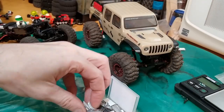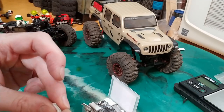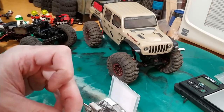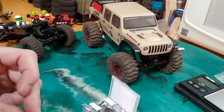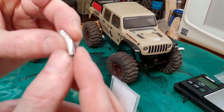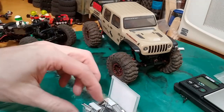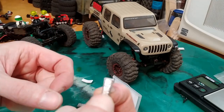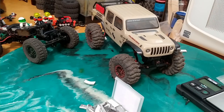So if you're looking how to get these bent like this, I just take a spark plug socket and a pair of channel locks, slap it down against it, and just squish it. You'll notice the channel locks have a little indentation inside of them, for grabbing pipes, round things. Just use that and go around, and you'll slowly get it shaped like this, which is pretty sweet. You get a bunch of them. I think it takes 5 or 6, and you got to cut one in half or quarter. Oh, kitty. Yeah, and that's pretty much that.